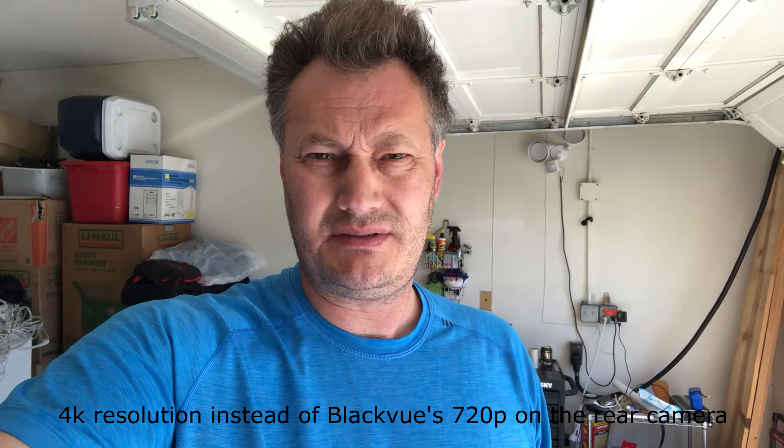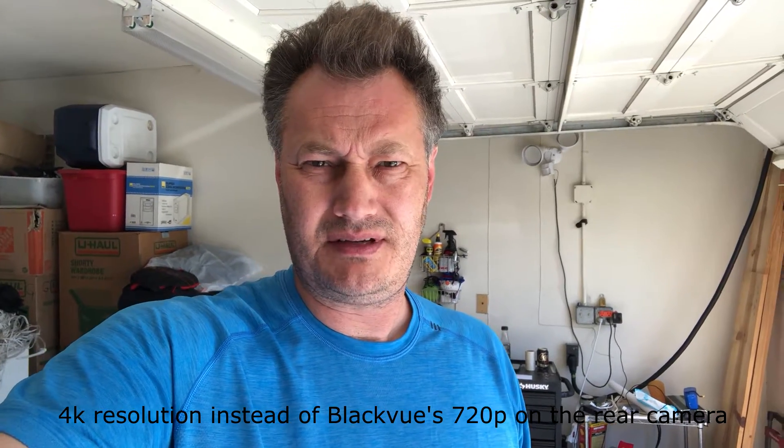So I decided maybe I'll get one of these. This is a tiny little GoPro-style 4K action camera. It was about $27 on Amazon and I played around with it — it actually works really great. It does loop recording so you can use it as a dash cam. As soon as the power starts it starts recording, and when the power shuts down the camera shuts down. So I thought maybe I'll put that in the back, but I need a 12-volt or 5-volt power source in the back. I read on a Tesla forum there is a way to get constant 12-volt in the back — it's actually supposed to go to the liftgate, but you can tap into that. There's a 30-amp fuse on that, so it should be fine running a camera off of it. I'm going to explore that and see if I can tap into that wire.